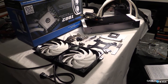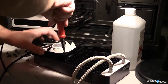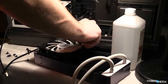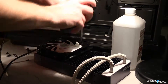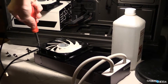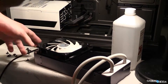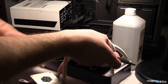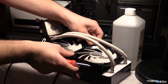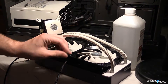The radiator is also screwless, held together by an aluminum shell on the outside — pretty nice looking overall. If you're not familiar with how radiators work, they basically run a liquid pipe from one side to the other where the hoses import and export the fluid, and the pump on top of the CPU pumps it. The aluminum fins found between the liquid pipes conduct heat from the metal pipe, which is then blown away by the fan — that's what cools down the liquid.